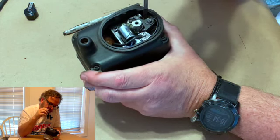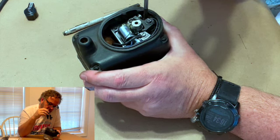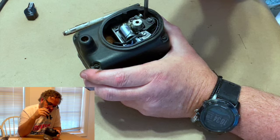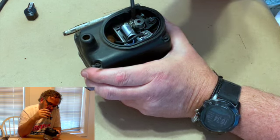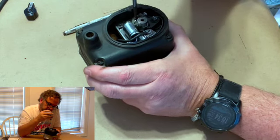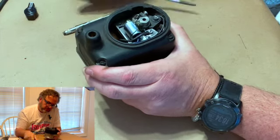If you looked at it, I don't know if you can see it on there, but that closed up. We'll just open it up till we get about 15 thousandths and then take it and close and tighten our screw. And what this screw does here is keep that from moving. So when you get it tight, make sure you still got your gap, and we do.